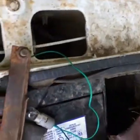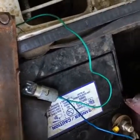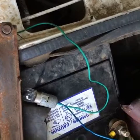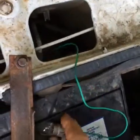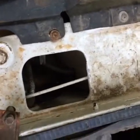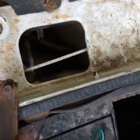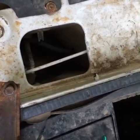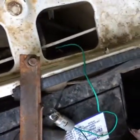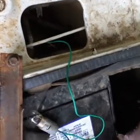This is a little test kit you can use if you're in the bush. With a Land Rover, you can use just this and you don't have to buy a whole tester kit, because this basically does everything on a Land Rover. It just lets you know if a cable has power coming through it. The bulb is quite good because it shows you — sometimes it'll be really bright if it's got a really good connection. If it's not so great, it'll just dim down. When you're doing that on small cables, if there's not much power coming through, it will show it in the bulb. You get used to it, but on a Land Rover you can pretty much do everything with that.